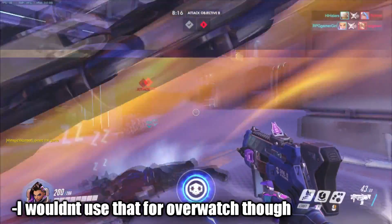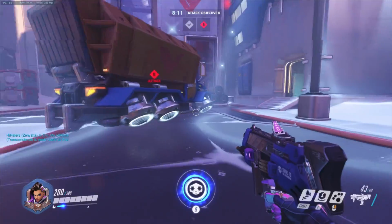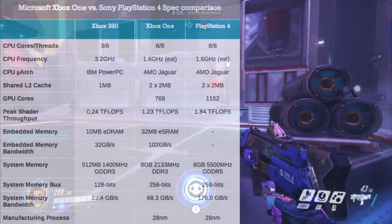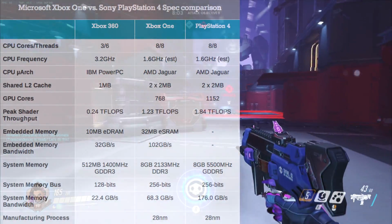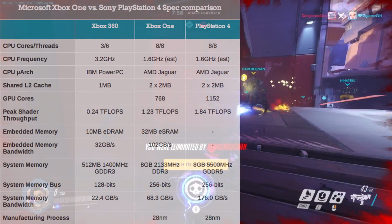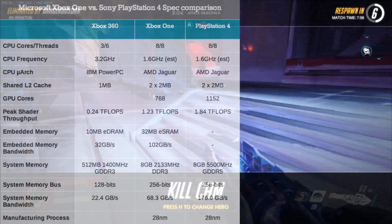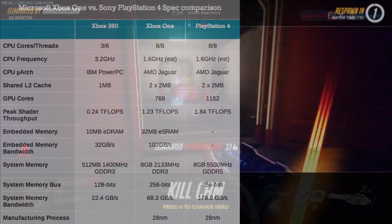Well, how does that compare to a console? Well, there's some pluses and minuses. That's a whole other video, but one thing I will say is when you look at the power of a PlayStation 4 or PlayStation 4 Pro, and they have a 4-core or 8-core Jaguar processor, the Intel i3 6100, or the AMD 6300 would spank that thing. And rightfully so. The console doesn't have to run other tasks like Windows and antiviruses and all that. So enough about that, that's a whole other video. Let's get into the build.